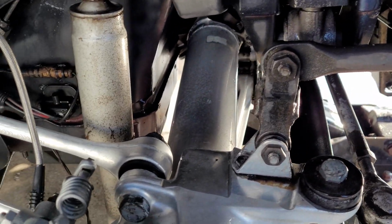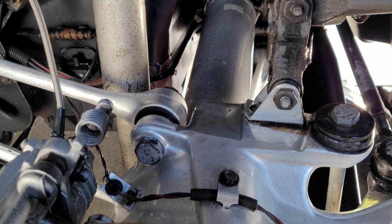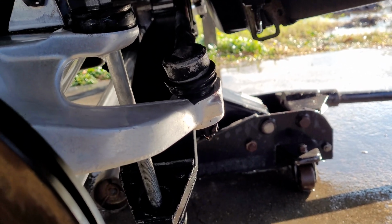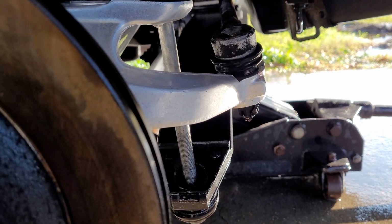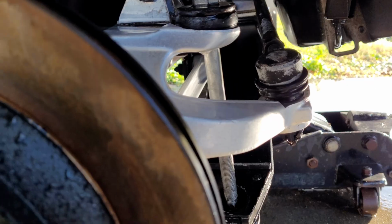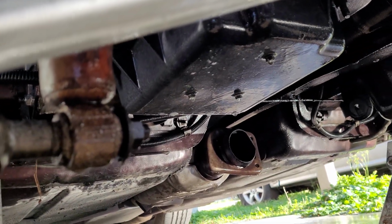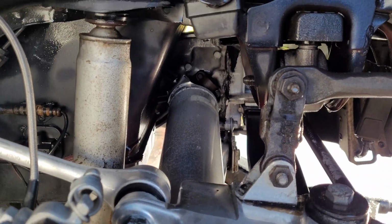But you spray that crap on, and I call it a scuff pad there, just to help knock some of the heavy stuff loose, because I'm not running an exhaust, and anybody who knows about these cars, when they start messing with EGR failures, it's nothing but fuel smoke. And since mine's dumping out the pipe there, everything's just covered in soot back here.